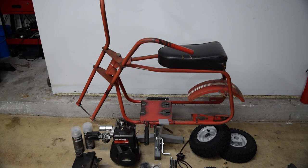The frame is a '72 Fox minibike frame, and it had a two and a half horse Briggs on it originally. I paid $60 for the frame and engine combo, which was too much, but I didn't know better. The engine was shot, and I'll show a clip of that shortly. The engine I picked is a three and a half horse Briggs that came out of a snowblower. That engine was $20 and it costs $27 to reseal it. I picked a snowblower engine because they're usually set up to run ungoverned and to run full throttle under load. It's three and a half horse, so it's not going to be quick.